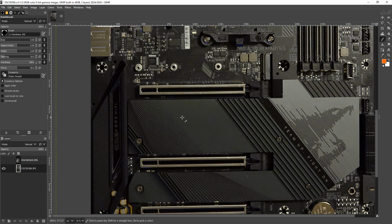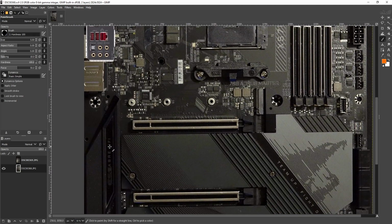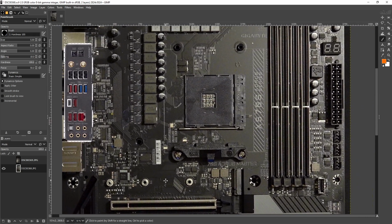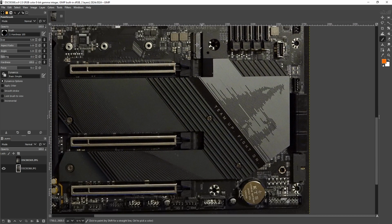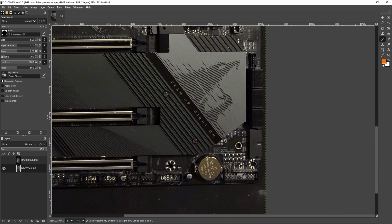So on a lot of say $200-ish X570 motherboards, you don't get an X8 slot, because the PCIe switches cost way too much for the motherboard vendors to be willing to implement that at that price point. And fair enough, those PCIe switches are really expensive. Anyway, that covers the normie connector side of things.